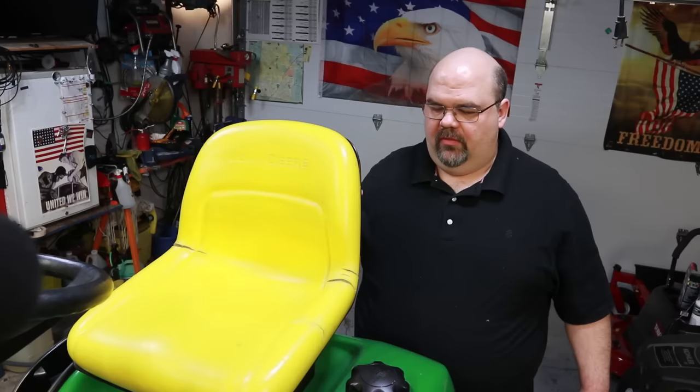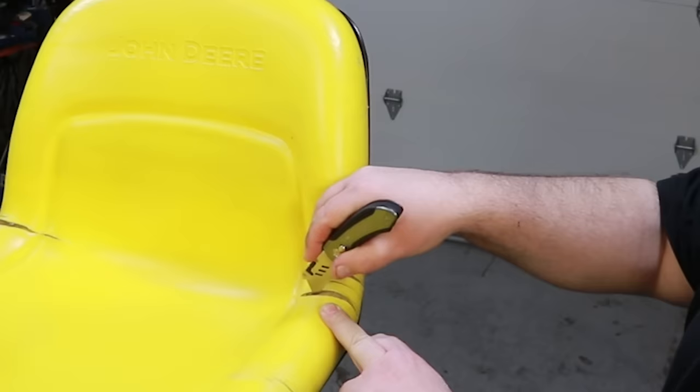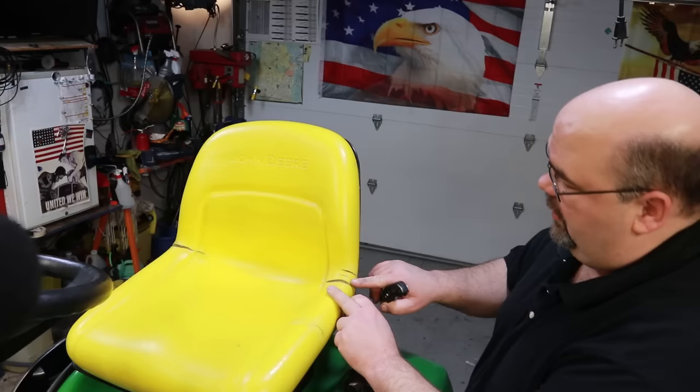Cosmetically it's not perfect, but it's very functional and it will help prolong the life of this seat. The prep work is what makes it last. What I'll do is take a knife and cut about three-eighths to half an inch deep so there's actually a slot there. You're not trying to cut out the foam, but you want a slot. For a small crack, use your better judgment if there's still some material.